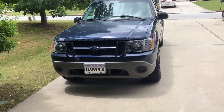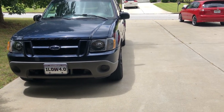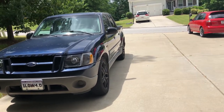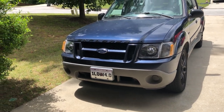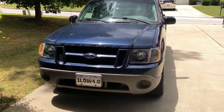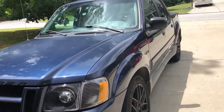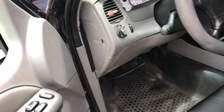I'm curious if it was a humidity issue because it rained yesterday and it was very humid outside — like 97% humidity when I went to bed. I want to check this bulb because it was very dim last night, and this one was locked in high beam. I'm going to pop the hood and see if maybe one of the bulbs backed out of the projector, which is a good possibility since we modified them to fit.